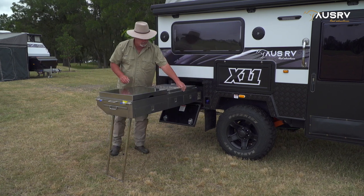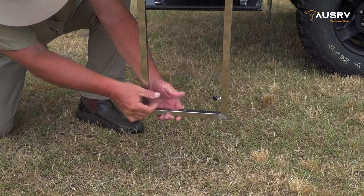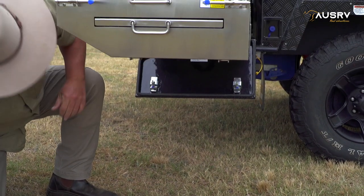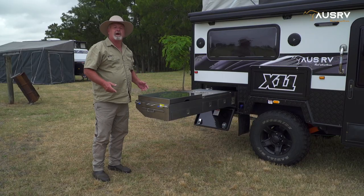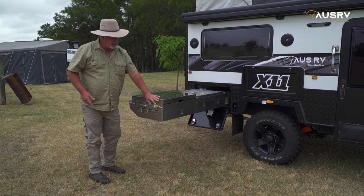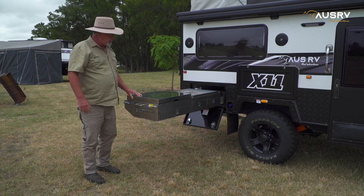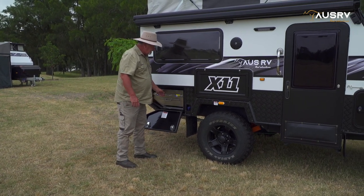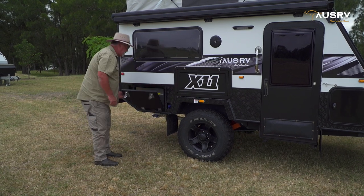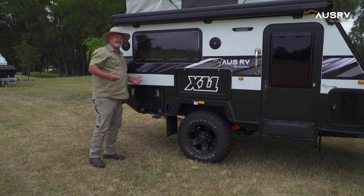Now we can close up our dish rack. Simply retract the support leg — make sure you tighten them up so they can't move. Swing the leg up and once in position push the bolt forward into the receiver hole to hold the leg up. Before we slide the kitchen away, make sure all the hoses and electrical connections are packed up underneath the cooktop, nothing hanging below the kitchen, and make sure the pad bolts are in their retained position so they don't strike the side of the kitchen opening. Slide the kitchen away and release the pad bolts. Kitchen's now secure — close it up. Make sure all the dust caps are back in place with the gas, water and electrical so they don't get any contamination while you're travelling.